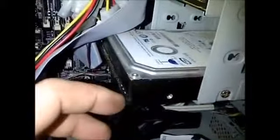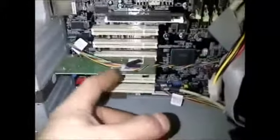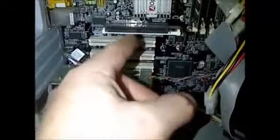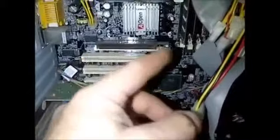Assuming your caps are good, my first step is to disconnect everything — my disk drives, my CD/DVD, the floppy — I disconnect those, and my hard drive. I disconnect both the power and the IDE cables so there are no peripherals on there. Then down here — I'm not going to take the time to unscrew this — but you pull out all your cards, even your video card if possible.